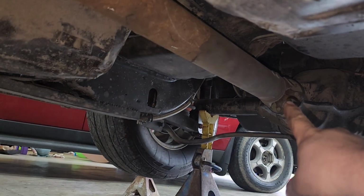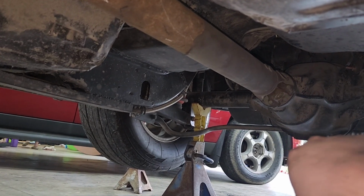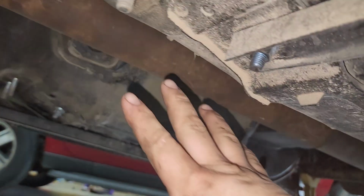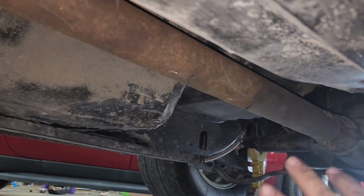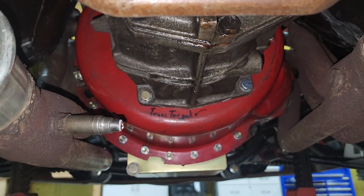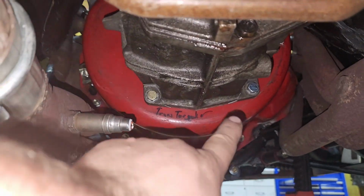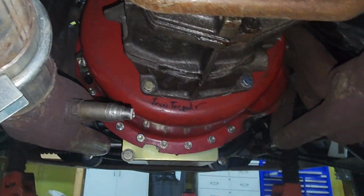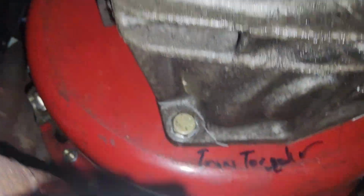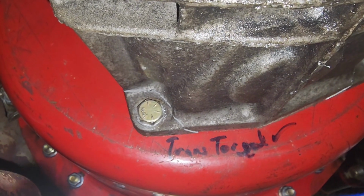So the last time we took this out for a test drive, my rear U-joint had a cap shoot out because it broke. So I had to throw this drive shaft in. I thought everything was okay. I got in the car and it went through all the gears and everything. When I get down here to come and adjust my clutch today, I'm looking around. I see something funky looking there and something funky looking there. When that U-joint left the chat, she took out my freaking T5.